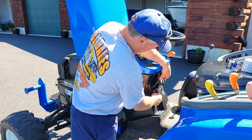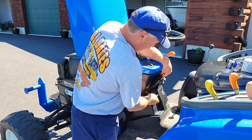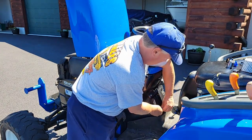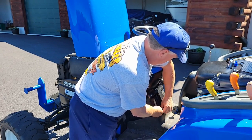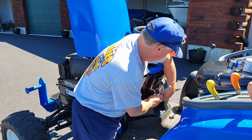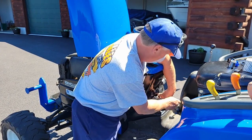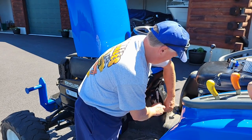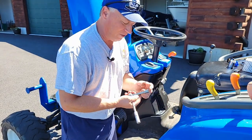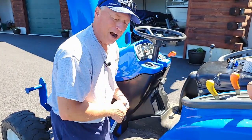This is why I say don't tighten up bolts at the bracket in the engine compartment, because trying to get all this stuff to align sometimes can be more difficult than actually changing out the switch. So I got the first one started. Second one is started. After everything lines up, then you can come back and snug everything down. Be careful not to over tighten. This shroud is plastic. Just snug it down. There you go. Also, if you have a deep socket versus a shallow socket, 1/2-inch, that does make it easier too. Let's go around and tighten up the last 2 bolts against the metal bracket in the engine compartment.